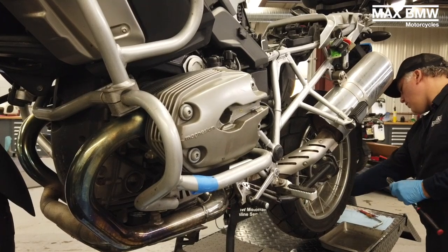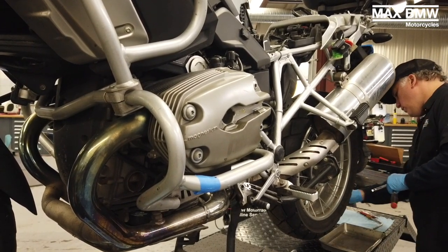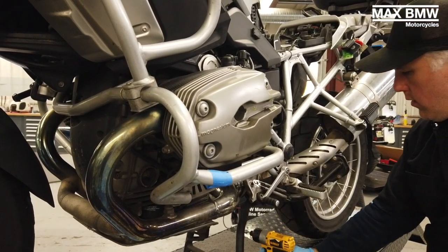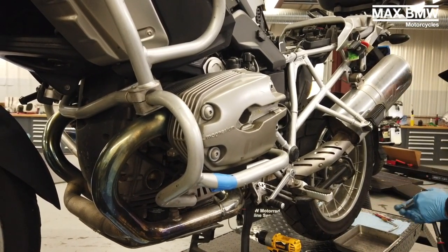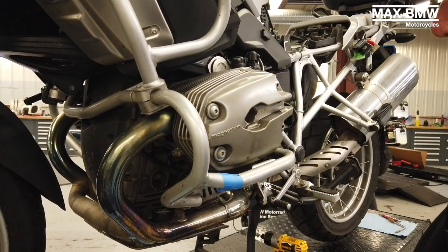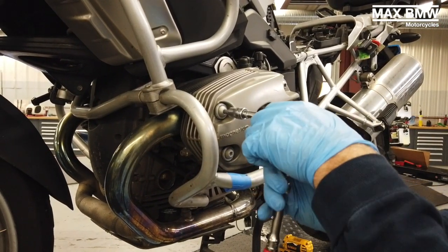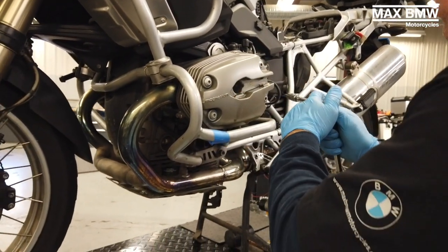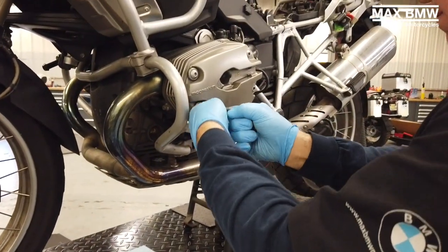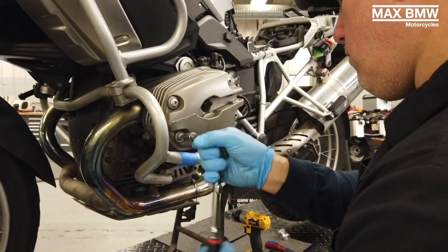In this next step you're going to need a little drain pan or some shop towels and brake clean, because we're going to be removing the valve cover. It uses a T40. And when you pull off the valve cover, it will spill out some oil. With this bike having the crash bars, it's going to make a little bit of a mess, but nothing that we can't handle.